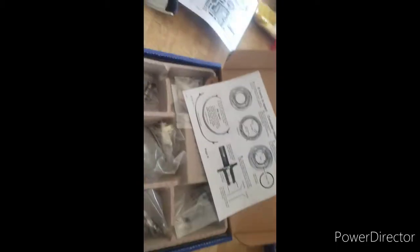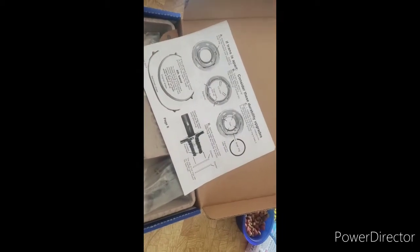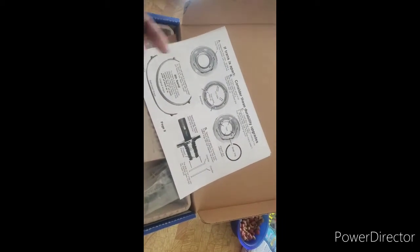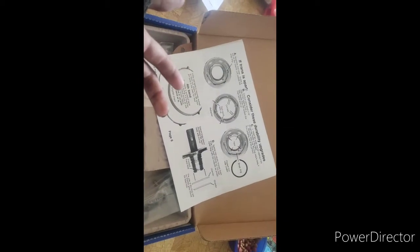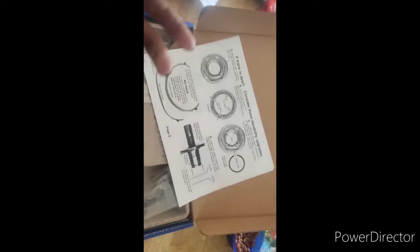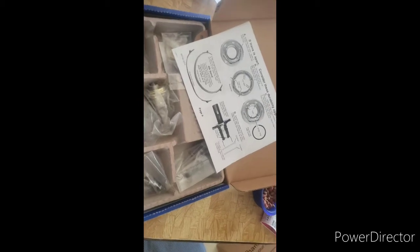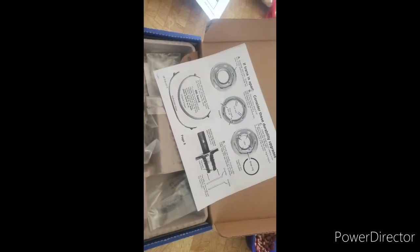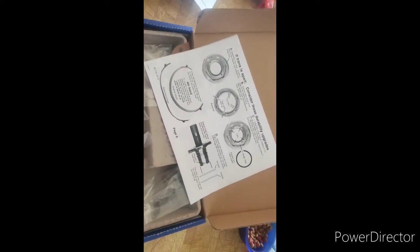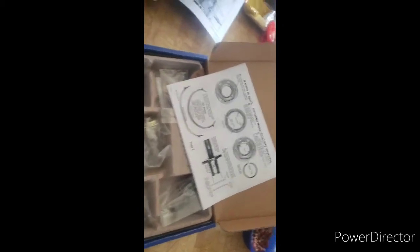Something I recommend anytime you have this Transgo part is to put the spiral lock kit on your direct clutch or your one-way roller clutch. It doesn't show it here, but I'll have a video on that because I am getting it. That is so you can run higher RPM. The problem with my transmission, the reason it went out, is I was running 6,700 on that trans, and it lasted a good long while, and went ahead and busted.